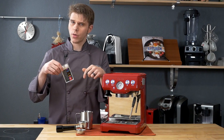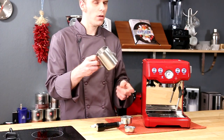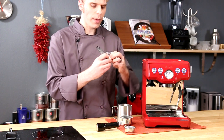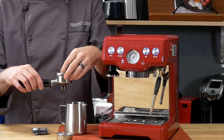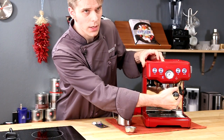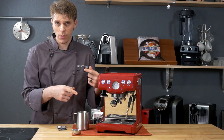Make sure to check out our link in the description below if you need to buy more of these. And finally, you're going to need a pitcher to catch the water as you're cleaning the machine — you can use the handy one that comes with your espresso infuser. Now, pop one of these capsules out of the blister pack. Take this capsule — it is not candy, do not eat it — and place it right there in the rubber stopper. Now attach the basket to the machine, lock it down tight, and make sure your water tank is filled with water because you're going to use a lot of water to properly backflush the machine.